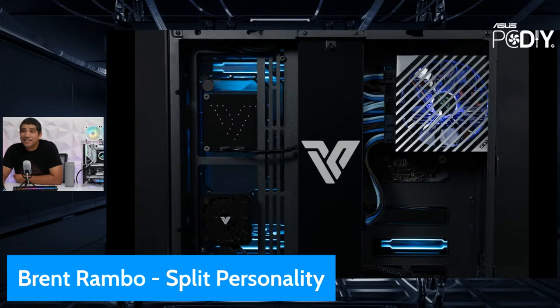Cool addition to see here is that it's the ROG Loki. So that's our SFX-L based PSU. So you can get this in up to 1,000 watts. It's also an ATX 3.0 or SFX based rated equivalent, right? New power supply, where you have the native 12 volt high power connection. So it can equally support these high end kind of compact systems.